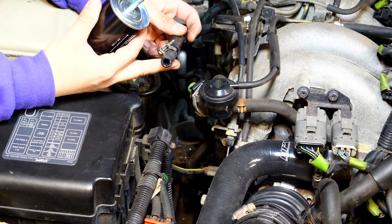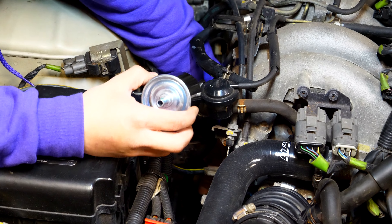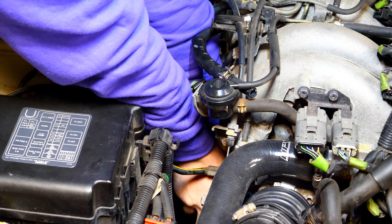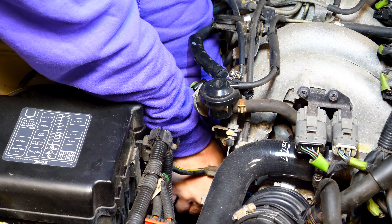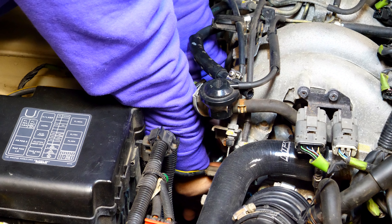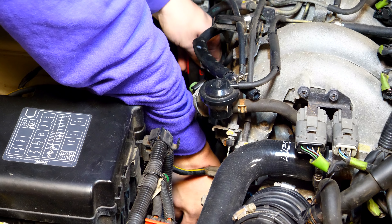This fuel line right here leads to the fuel rail. We're not installing that one yet — we're setting it aside and working with the hose found down below, because we want to first install the bottom one and then the top one. You just slide the fuel filter over top of the hose and then slide up the little clamp over top of the hose. The clamps are made out of stainless steel as opposed to regular steel so they won't rust or corrode. Once it's where it needs to be, tighten up the clamp with a Phillips screwdriver so the hose is secured to the nipple.